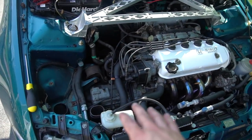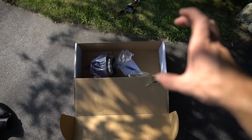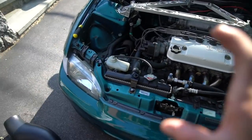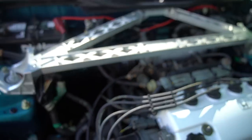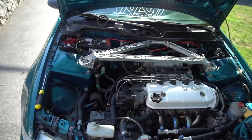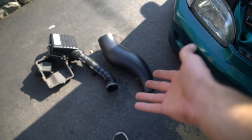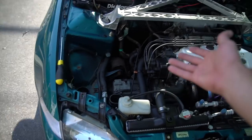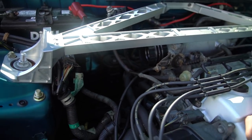Now that we have the intake out of the car, the first thing you're going to want to do is grab the little rubber sleeve from your package that goes over the intake manifold. Pop that on, tighten that down, make sure that's all set. That will give you a little bit more flexibility for when you install the actual intake into it, because this is a fairly large intake tube and it's kind of hard to fit in here with this strut bar. It'll take a little bit of finagling, but we'll make it work.